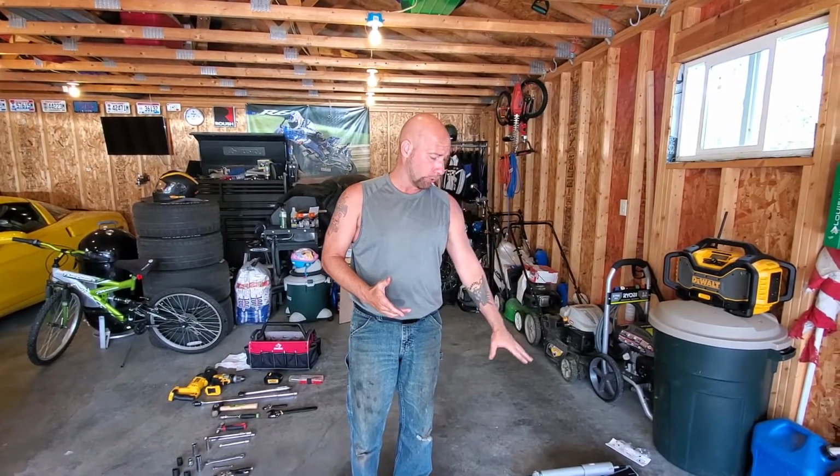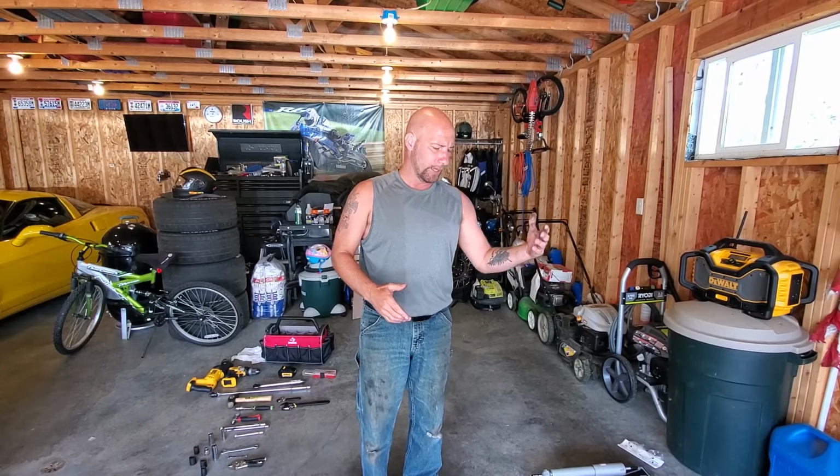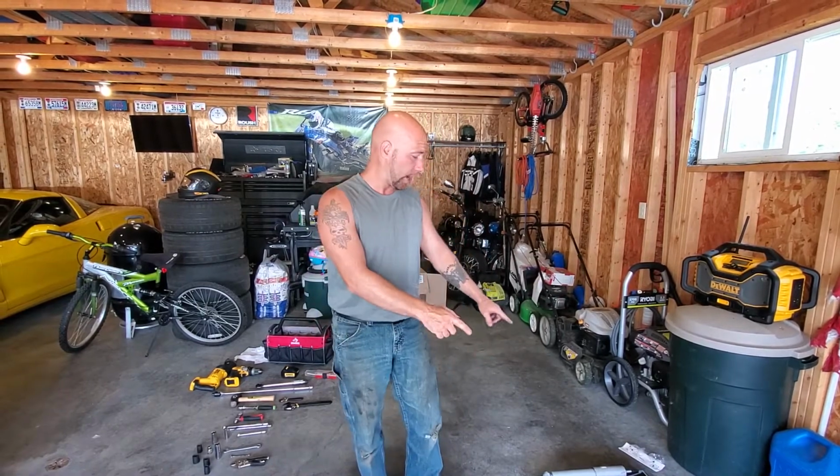So he's probably not going to spend a whole lot of time on the track, and it's almost triple the cost for the Bilsteins. We're not really going to get the use out of those as far as the additional handling that they would provide. The KYBs are a lot cheaper, and they are going to give us a little bit more Cadillac ride, I think. So that's what we're actually hoping for, and obviously, like I said, they're a lot cheaper.